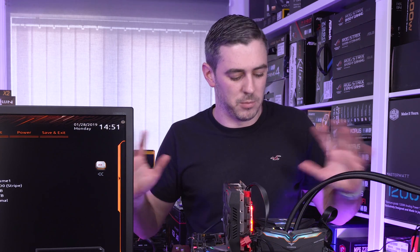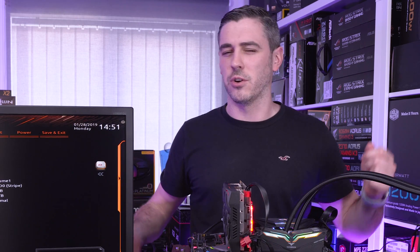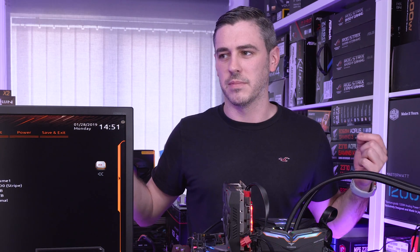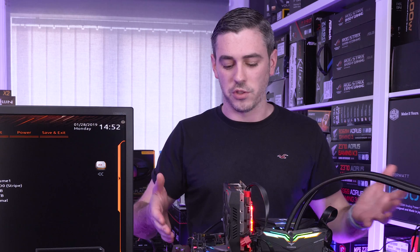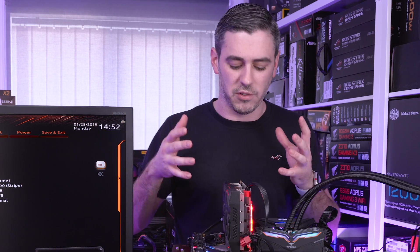The results were absolutely abysmal, and we tried to rack our brains on it — is it the drives, is it the board? I think it's Intel. A lot of people flamed me in the comments of the last video saying 'read the manual' and 'Google it.' Well, we did read the manual and we did Google it, and those were the results that we got. That's why we moved to a board that specifically said it supports three drives in NVMe RAID. The biggest problem is we've gone from X299 down to Z390, which means we've lost some of the PCIe lanes. I think that's where the problem lies — not being able to get as much information from and to the drives because of the limitation of the PCIe bandwidth.